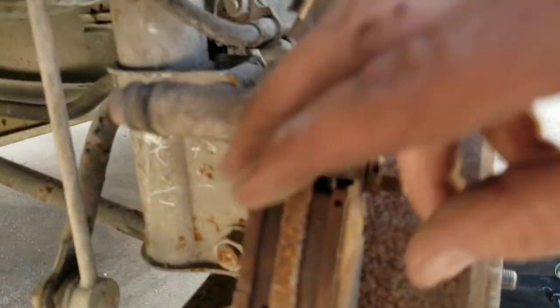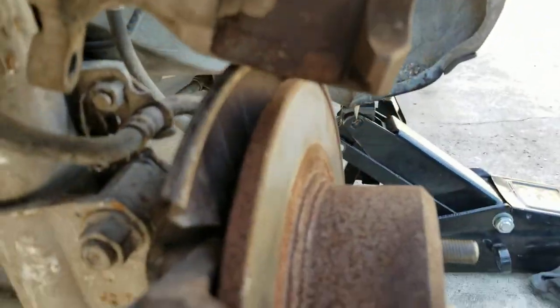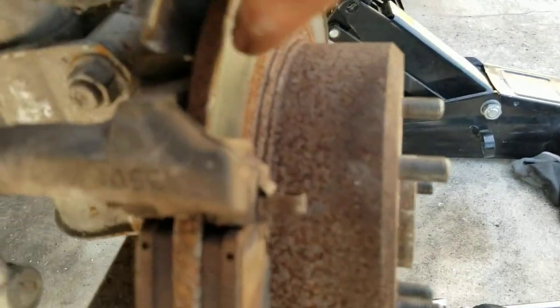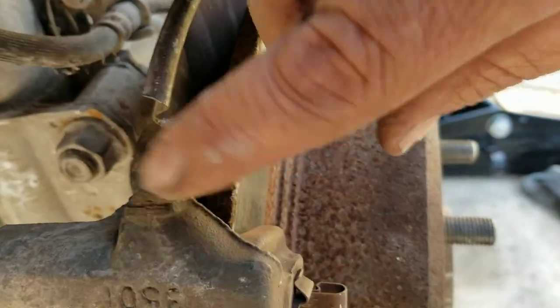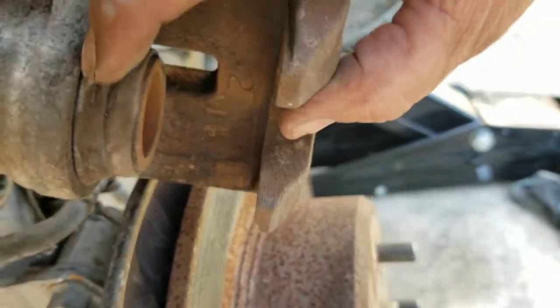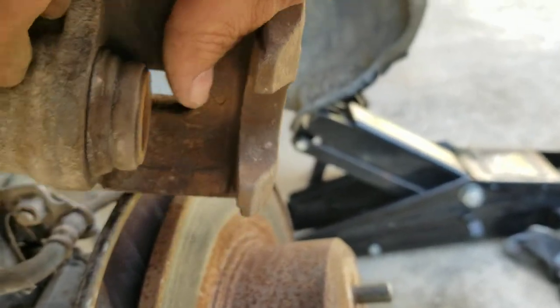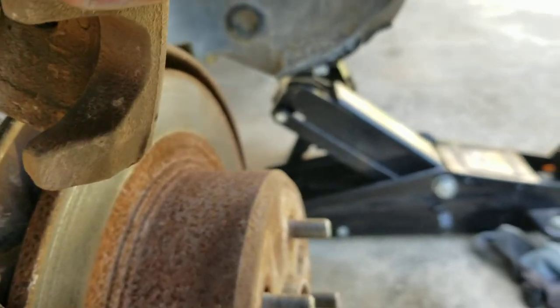See what I was talking about - you see where the brakes are, you see this piston is pushed out over here. If you get a new caliper or new rotor, the new caliper is gonna be thicker so it ain't gonna fit in between here - you won't be able to get this back on there. So you got to push this caliper back. You can use a c-clamp to do that.